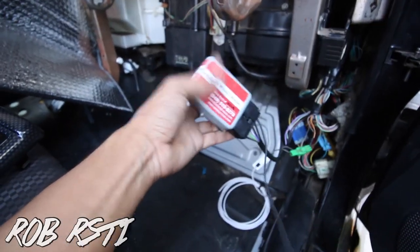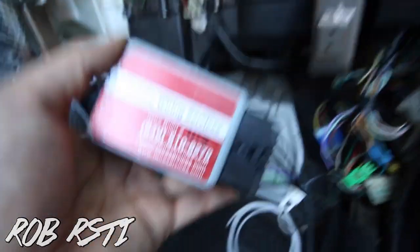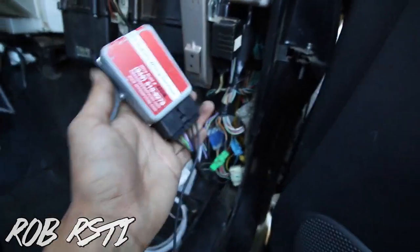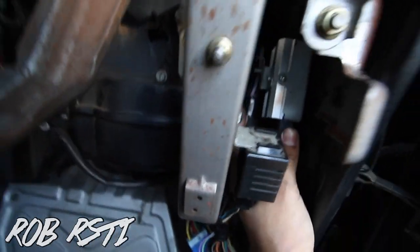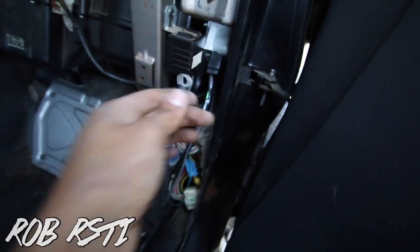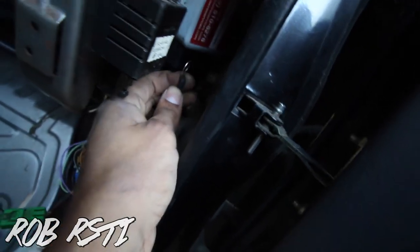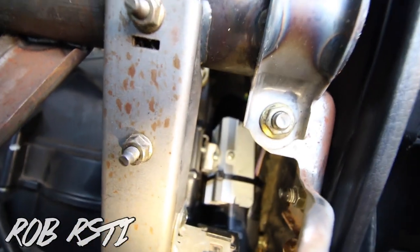The last thing to do is wire up the fuel pump controller. This is what it looks like — iWire gives you this when you get your harness. I'm build number 1114. What I'm gonna do is put it under here next to like the AC controller, zip tie it to the harness. It has its own ground — do not ground this with anything else. It should have its own dedicated ground. There's a separate hole right here specifically for it. This is what it should look like — the fuel pump controller zip tied to the harness.